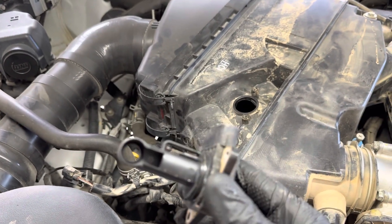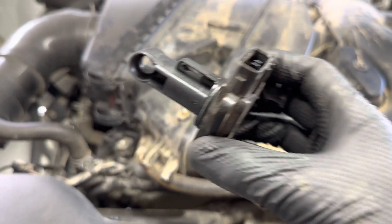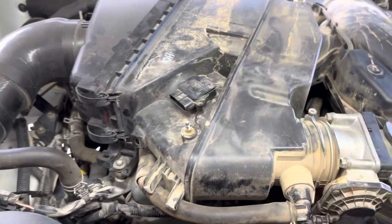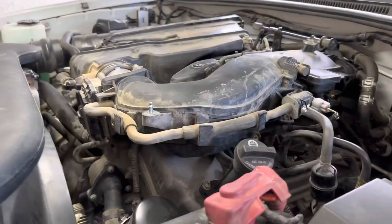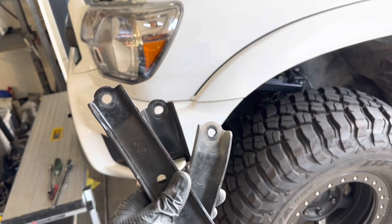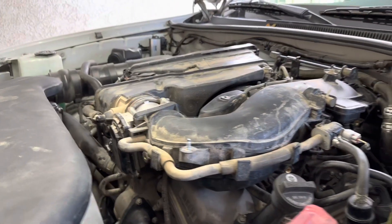Get a can of MAF cleaner — just takes a few sprays, got it all cleaned up. Then I put a small skim coat of lubricant on the O-ring so when you put it back in you're not fighting anything or pinching the O-ring, and it just drops right into place. Then put the screws back in and plug it up. Moving on to the last step: the three brackets that hold the manifold on this side for structural support. I slotted the bottom so the top uses regular bolts and the bottom is slotted to account for the half inch the spacer added to the runners.